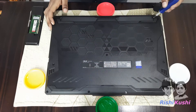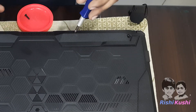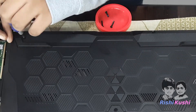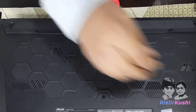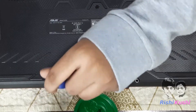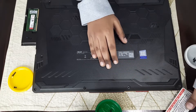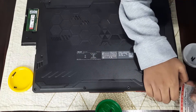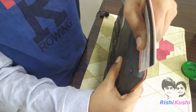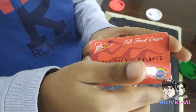Use a small size star screwdriver to unscrew. There are 11 screws with different sizes on the back of the laptop. To avoid mixing them up, we are using small lids as placeholders for those screws. Remove all 11 screws carefully and keep them safe. Kindly use a pry tool to unlock the back cover. As we do not have one, we tried using an inactive smart card.